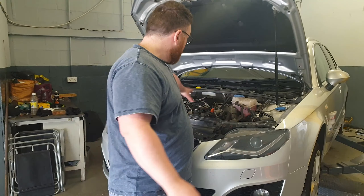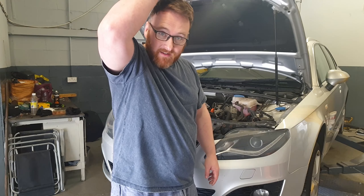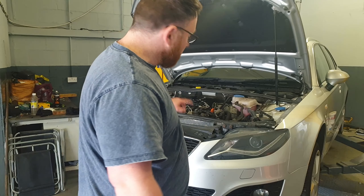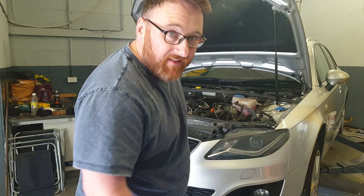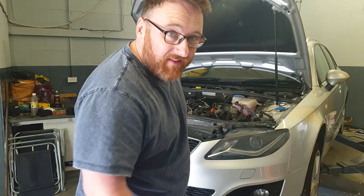This car has been made by the Volkswagen Audi Group, which means it's a substantial platform share. The B6 means it's an Audi A4 in this instance. They all share the same basic layout, the same architecture and the same engines. This one's a 2 litre TDI, and the first thing you'll note is it's front-to-back as opposed to a transverse engine. But that does not mean it's rear wheel drive — it's got a transaxle driving the front wheels. And it's horrendously close to the front slam panel, which makes doing a timing belt on it a bit of a pig.